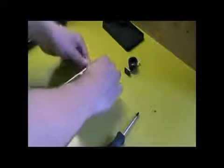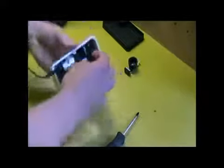Now sometimes there's a flipper valve. I don't know what this part of the pump's called, but it's like the bellows or something. You can pull it out. On these cheap ones it's actually manufactured right into it. On the more expensive model I'll show you later, you can actually replace the flipper valves, but if they break or they stop working on these cheap models, there's very little you can do about it. So I'll just replace that because there's nothing I can do with this one.